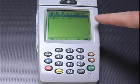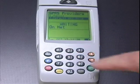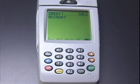Assuming the start screen appears correctly, choose your GPRS provider. You always want to choose the second option by pressing the number 2 key that reads Default NCC Provider. The wireless terminal will now connect to the network. When Credit Sale Account appears on the screen, your wireless terminal will be connected.